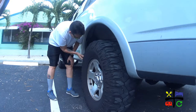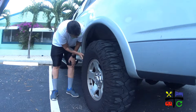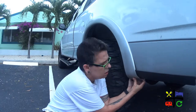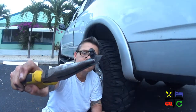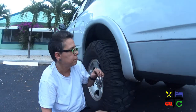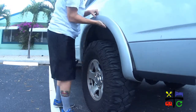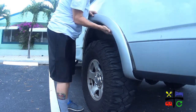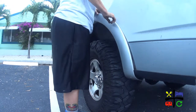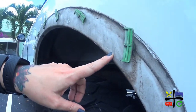This might not be an option for everyone, but if your truck or car or whatever has these small fender flares already installed, you definitely should take them off first. So Lou's going to take care of that before we begin the installation. It's like a plastic screw or a clip. You definitely want to pull those out when you're pulling out the fender flare — pushing up as she's removing it, because those little holes have like a little slit on the top. So you push it up so that it angles perfectly through the hole and then you can pull it out.